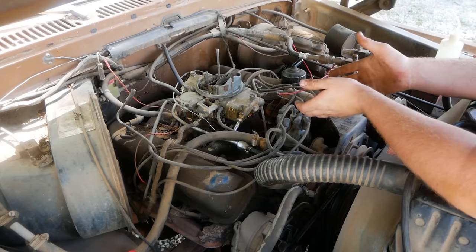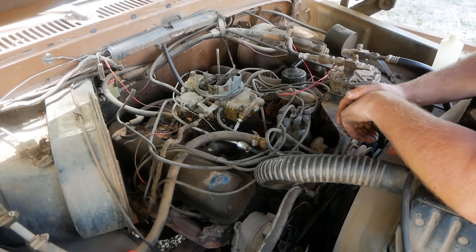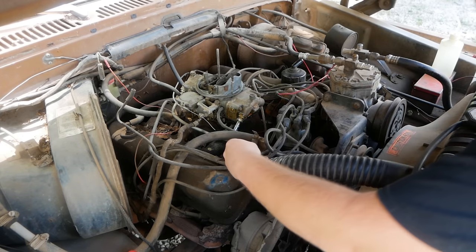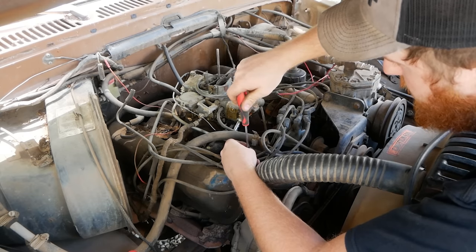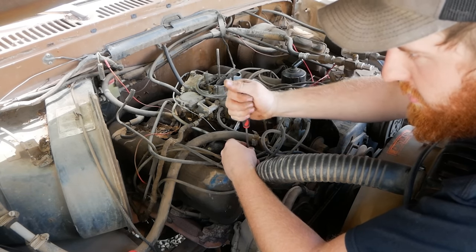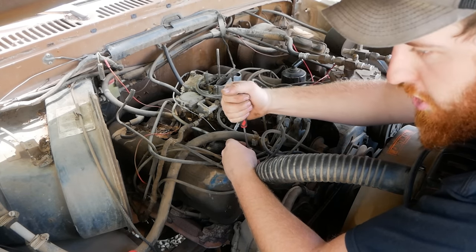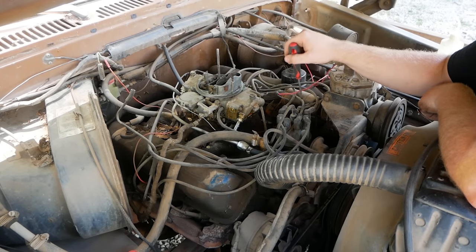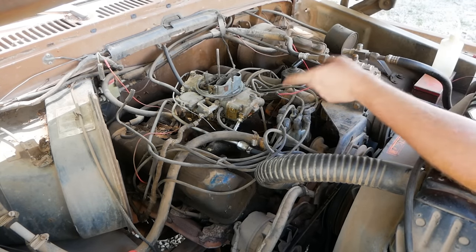You've seen us run stuff off of what's in the tank before, and I've learned that that is a big no-no with the Bronco, when it started gluing all the valves and the valve guides. And now we need a new motor. Run an external tank until you have time to verify that the tank is either good and clean, or you flush it out and put fresh gas in. Either way, whatever you do, always put a filter before your fuel pump so that you catch all that crud and don't pump it into your carb.